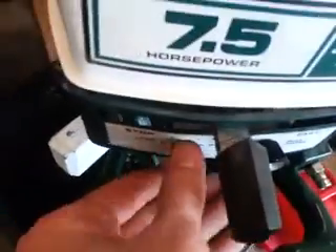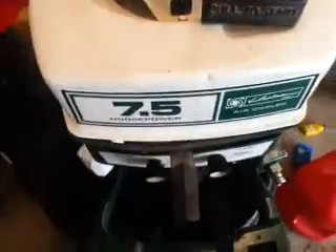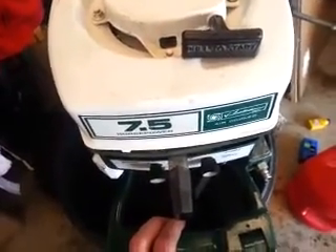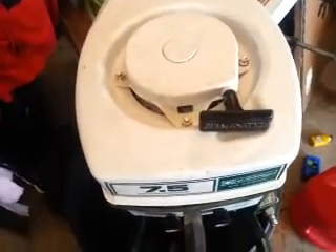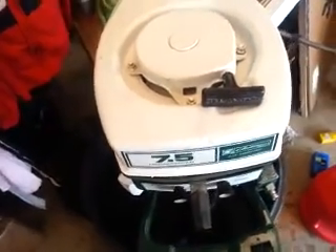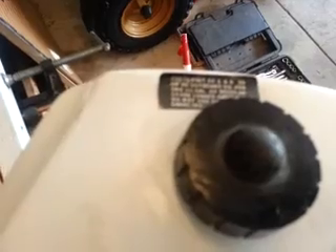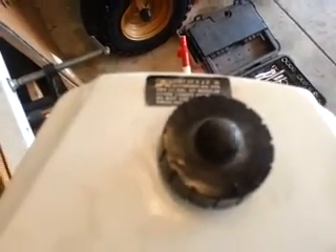I have no idea where the lean idle mixture should be, but obviously the choke goes in and out. There's no air filter on the carb, so it's a rather archaic system, but they move — there's tons of videos of them on YouTube. People are always asking what that label says: use a quarter pint of 30 or 40 outboard oil per one gallon of regular grade leaded gasoline — do not use unleaded gasoline. So this has got leaded additive in it because I'm a geek.